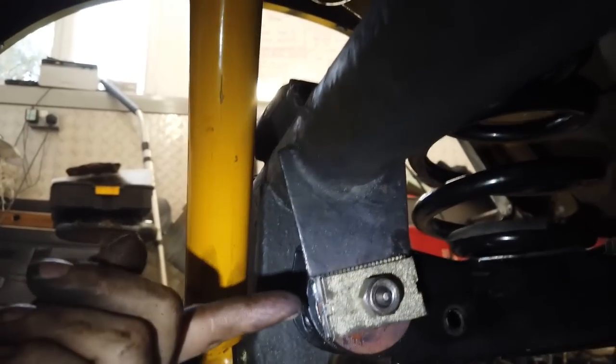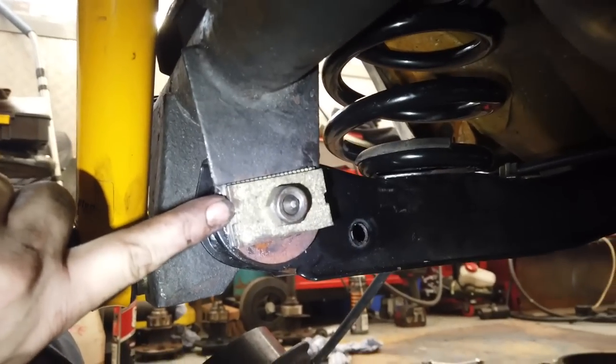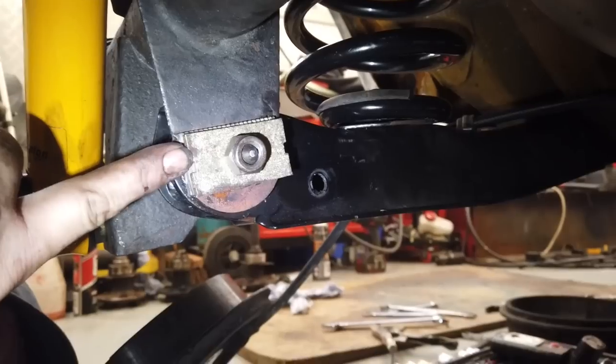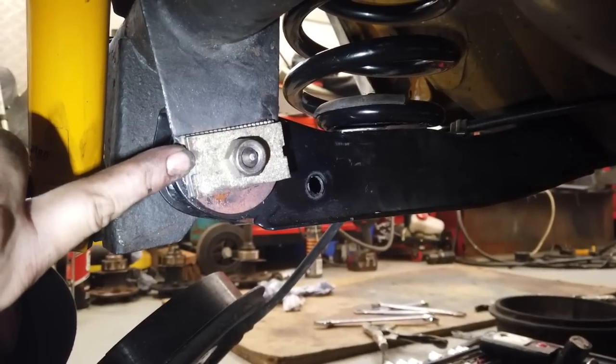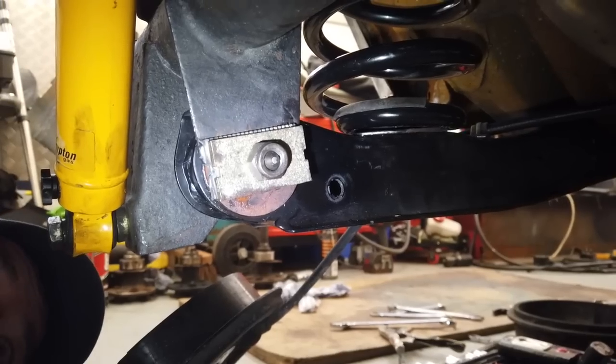Here are the bolts at the end that are adjustable. In fact, on Richard's side, you'll see it better because it's facing my way. Richard points it out now, the bolts. Let me just stabilise you here. You can appreciate at home, it's not always easy filming in this environment, but there we go. A centre screw for your serrated plate, and that will lock the nose angle of the diff either upwards or downwards. In our case, it's most likely going to be pointing up all the time, simply because the gearbox and engine point down, so we can lock it in exactly the right place and it shouldn't slip in the future.